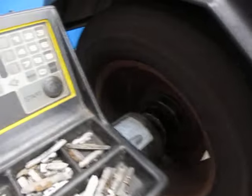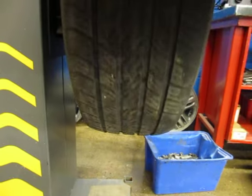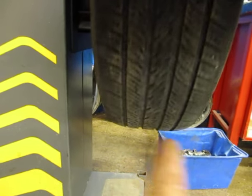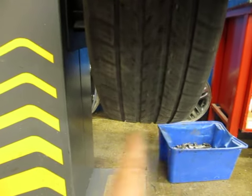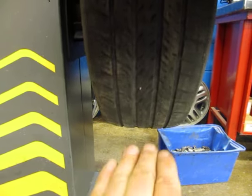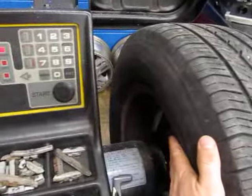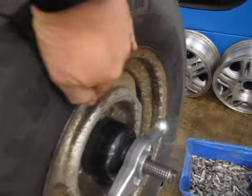The wheel spins. Watch for any wobbles — look at the bottom of the wheel. We're checking for side-to-side wobble or up-and-down wobble. Wobbling one way indicates a bent rim; the other way indicates tire damage, like a broken belt. After lifting the hood, the machine is asking for 0.75 ounces on one side and 1 ounce on the other side.